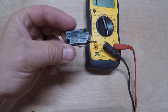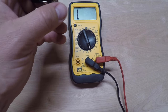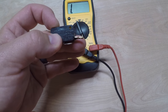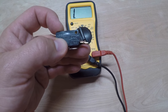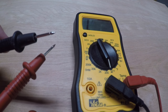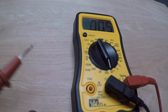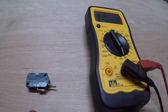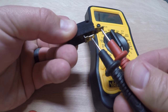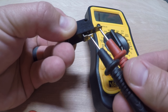If you want to test these switches, there's an easy way to do so if you have a multimeter. My multimeter has a tone setting which is a continuity tester. All this does is either the pins are connected or closed based on how the button is depressed on the switch. So if it's open and they're not connected, when I push it down they should be closed. If it's closed when connected and I push it down, it should be open. That's what normally open and normally closed means. Right now we're open and now we're closed - you should hear the tone: open, closed, open, closed. That's what a good switch should do. While I have it set on continuity, I put one lead in one hole and the other lead in the other. When I press the button, you will not hear sound if the switch is not working. There's no sound when I click the switch on this particular one - confirming it is bad.